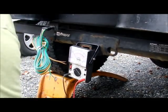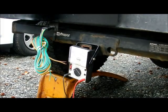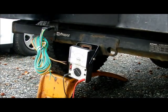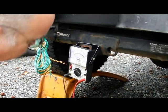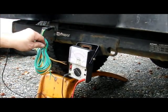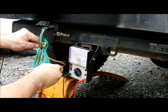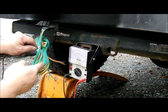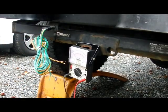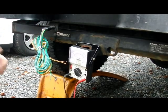So what I'm going to do is turn the turn signal — it should show up on that other one. I'm going to flip the turn signal. Okay, so the green has the turn signal, and that one has lights. I got a turn signal bouncing back and forth. So as long as you've got lights on those two wires, you have brakes. No issues there — the wiring is good. The plug-in is good. I'm happy.